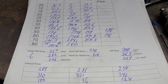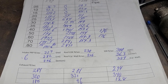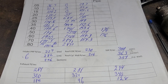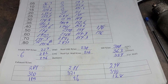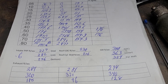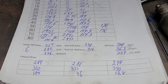Supposedly the valves have been ordered. I would actually like to leave the guides and the seats until I get the valves — that way I can hone the guides if they need it and then do the valve job. We'll see how long they take to get in, because I don't have a lot of patience and I have a bunch of other stuff I've got to get done.